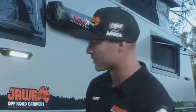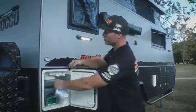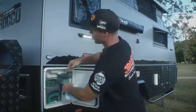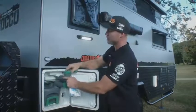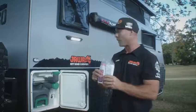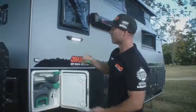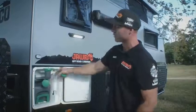The toilet cassette runs off a separate tank to your actual water tanks. It's a 10 litre fill. Remove the cap and don't forget to add on the extension situated on the cassette. Place this in. You're supplied with one chemical for the filler and one for your cassette. Fill in your water. It runs off its gauge here to notify you when it's full.